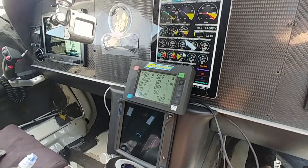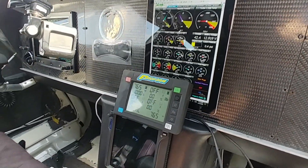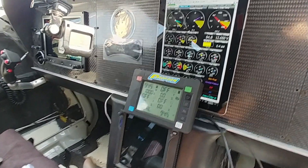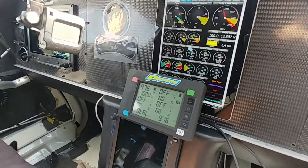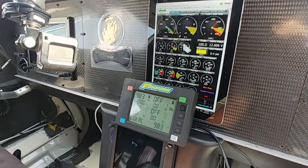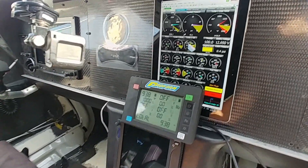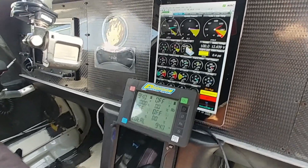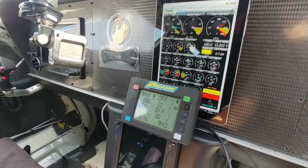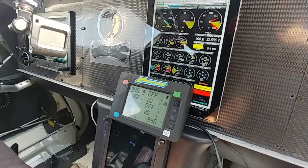Next up I wanted to verify the power I was getting and see if I could increase it a little bit more. I don't really have any video, but I've got the nose wheel sitting on that scale again with the remote display in the top left corner. I took the engine up to full power and then tried it through different settings for the governor — basically taking it back to a fatter prop setting, from 3,720 RPM on the engine down to about 3,000 — and just measured to see where the best power was. As you'd expect, it's right up where the RPM is highest, so that's where I need to keep it.